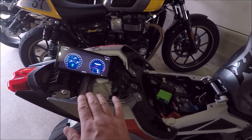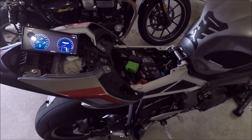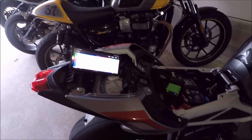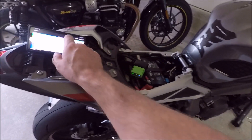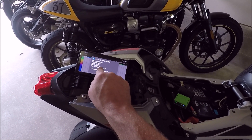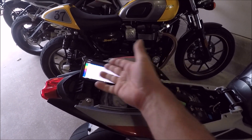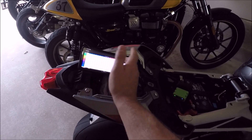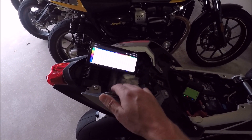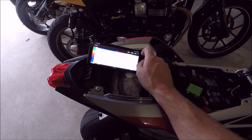Make sure your battery's topped off. You can only do this from Android — there is a Windows version of TuneECU but it doesn't work on this bike. You have to use Bluetooth and Android; it's the only way to talk to the ECU. If you've got a tuner who knows TuneECU and is familiar with these trim tables, they can map the bike for a full exhaust or whatever mod you've done and push it to the bike. It will tell you how many times it's been written — I've written to it five times — but it still looks like 31044 to the dealer. Unless they really knew to open up individual tables and cross-reference, I don't think they'd know you've modified it. But that's always the risk — use it at your own risk. It's a very simple process. Hopefully you find this interesting; throw any questions in the comments.